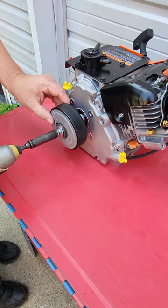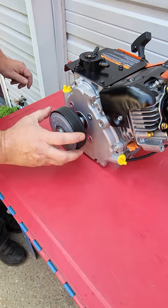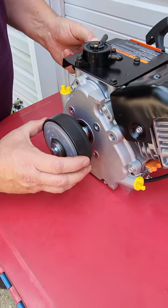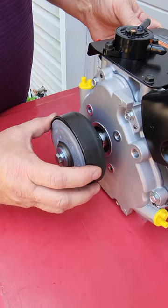I'll use an impact with just a light click. Check to make sure that you've got end play in the basket — the drum should move in and out slightly. This one's about thirty thousandths.